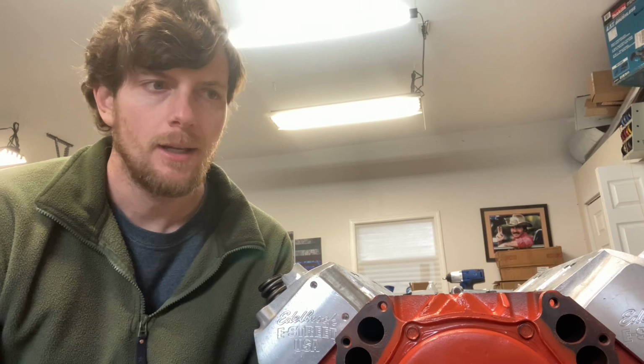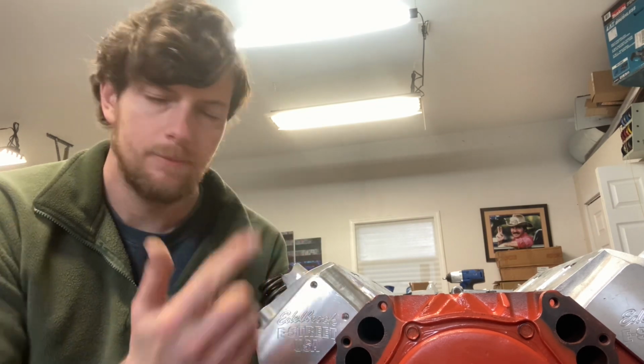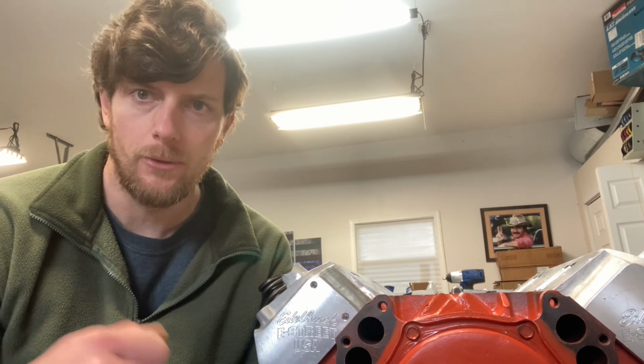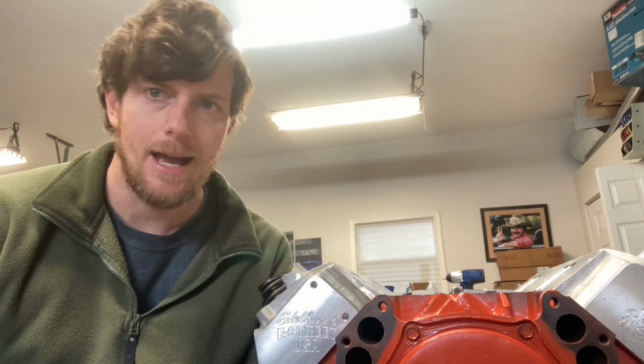Okay, so I had to make a part two to this video, but I'm putting it in with the rest of it. Anyway, I called 440 Source because I'm actually using their rocker arms on this engine, and I put my other head on while I was thinking. Talked to a super nice guy. I explained the issue to him and said my 400 rods were that way, this other guy's 440 rods too. He said they have had some calls, and if you have an issue, they'll gladly take them back, exchange. They now have a measurement tool on the property and are going through checking full sets of them. Any rods where the pin bore is wrong, they set aside and send back to the manufacturer. So it's nice that they are taking a precaution on this.